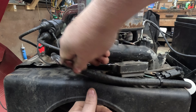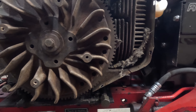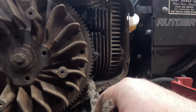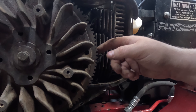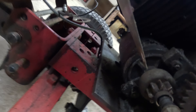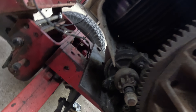There — thank God, it's a good thing we're doing this. Look at this. I don't remember this from the last time I had it apart. We'll go ahead and blow all that out. The reason we came that far is there's two bolts in the front of the starter we need to take off, so let's go ahead and get those.